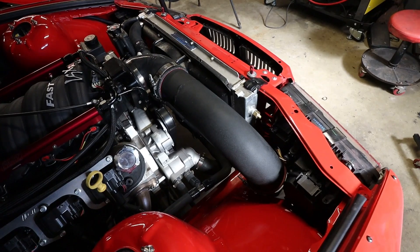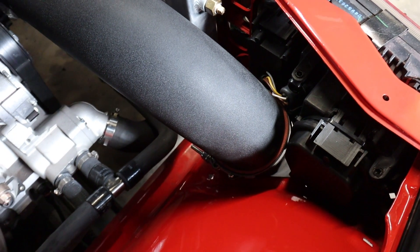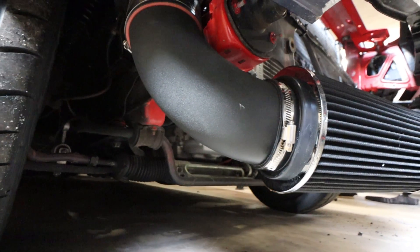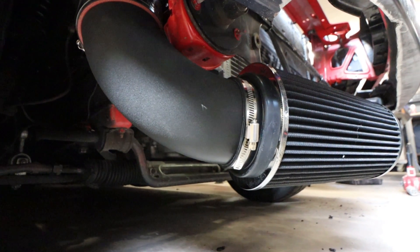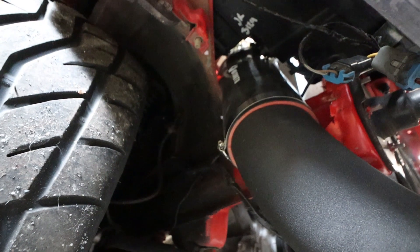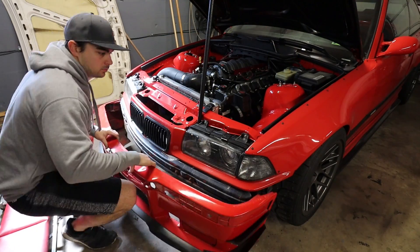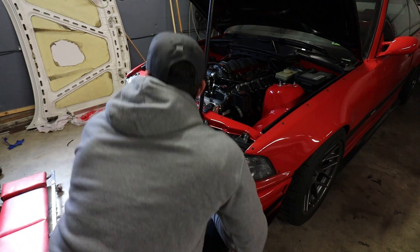I'm freaking pumped about this — this turned out excellent, looks really nice, and I think it's going to do wonders for the IAT. Down below near the fog light slash bumper opening, it fits in there really really well, everything's nice and tight. I might end up making a mount down below for the filter just to make sure it doesn't go anywhere, but I want to do some testing first. It's four-inch all the way through, big filter, should be drawing in nothing but cold air. With the relocated IAT sensor I think this is going to work out perfectly. I'm going to throw the bumper back on for the final time and wrap this project up.